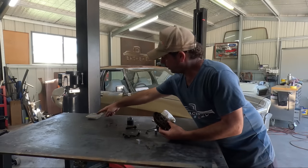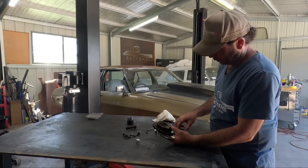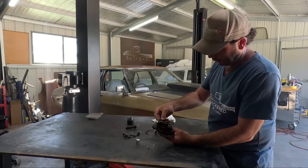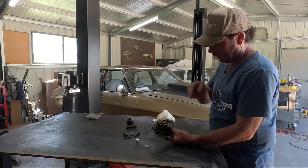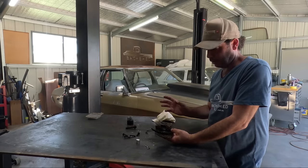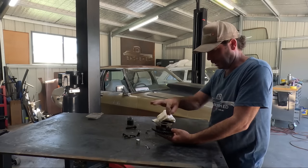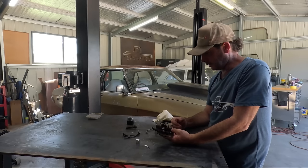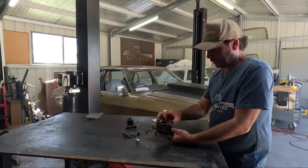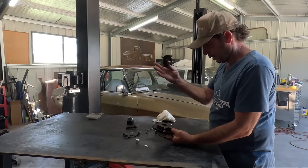But I've got little nails that I'm going to put in those pinholes, line my reluctor wheel up, and then weld that reluctor wheel on. So it's basically one unit. It's no longer a cam phaser, it's just a cam gear. And then I'll just pull the nails out of the center. Sounds easy. So let's get into that. Righto, I'll lock them out at the back, then I'll grind this up, we'll weld them out.